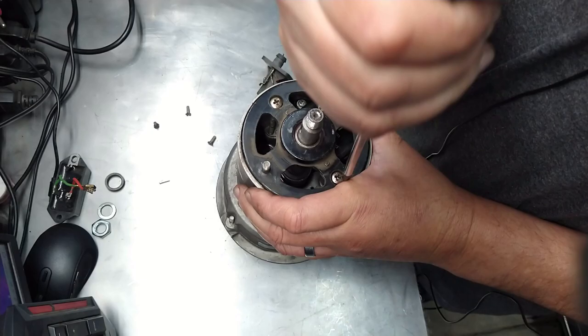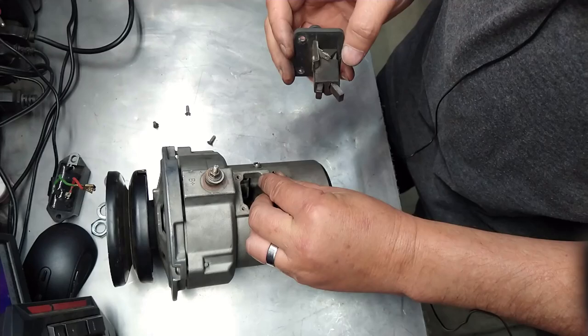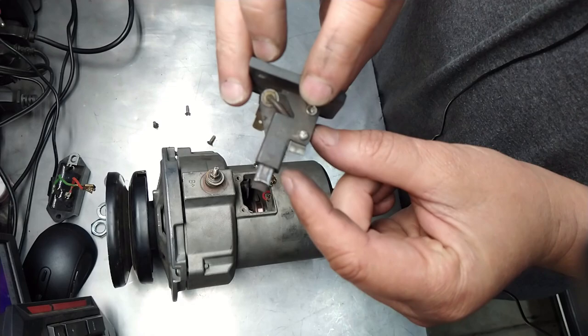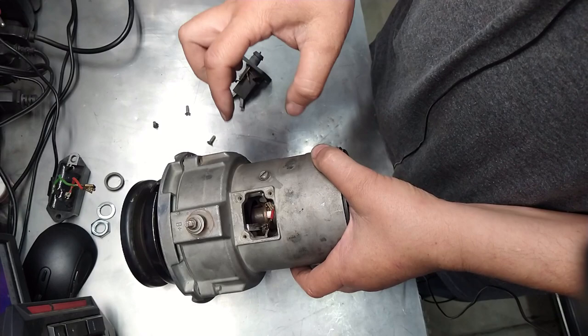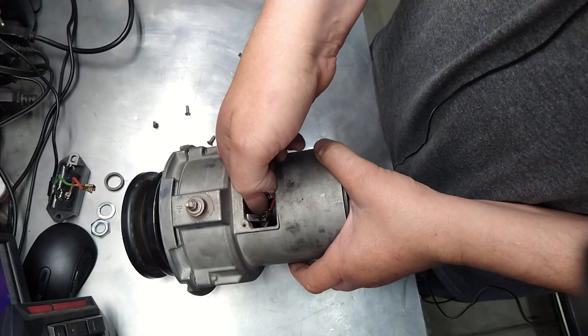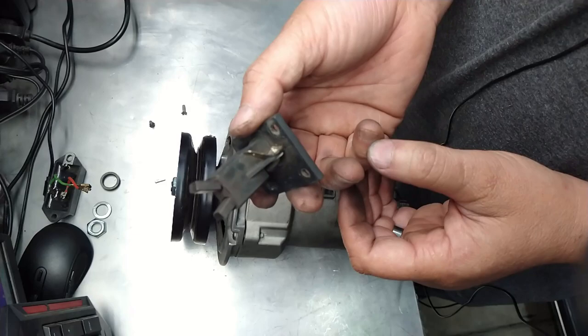Anyways, okay, so wires, they're right here. Pull them up and align that. This metal thing has a little contact right there. That one is going to go right to this metal here. So make sure that this metal hasn't bent down and is no longer touching here, because then you'll get a failure. If you have to, bend it up a little bit, see how I'm bending it up? Just so that it does contact this. Now, if it's doing this, obviously you can't put it in like that. If you do, it ain't going to go well.